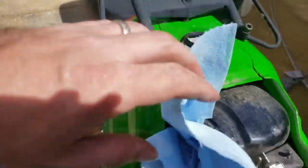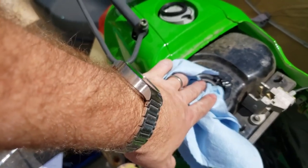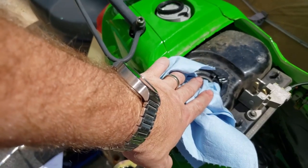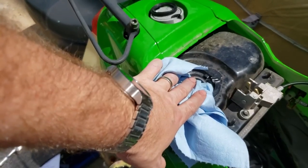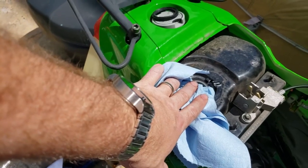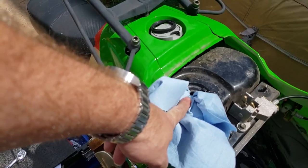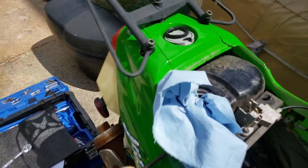The fuel filter was also filled with rust. I think I'm going to purchase another fuel filter — they're cheap. Trying to clean out all the rust floating around in the bottom of the fuel tank very well could be the reason this hasn't been running well. I'm going to work on that, get the panels put back on, and since I have to buy a new headlight bulb anyway I'll order the fuel filter at the same time and see if that makes any difference.